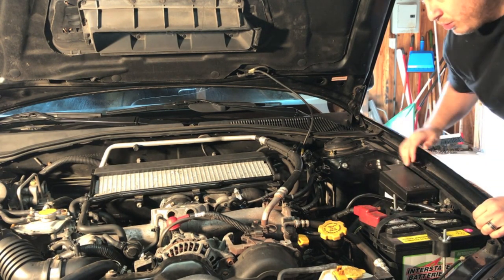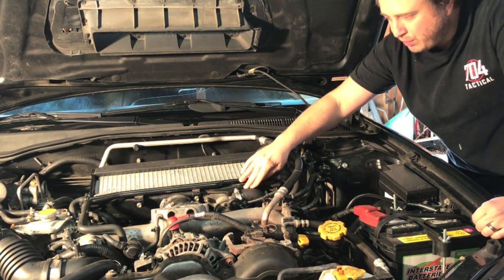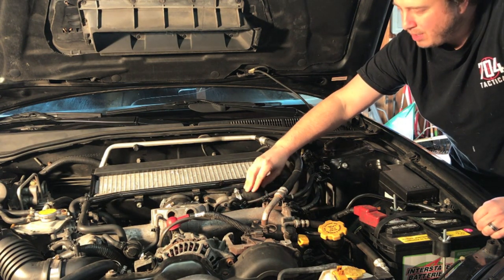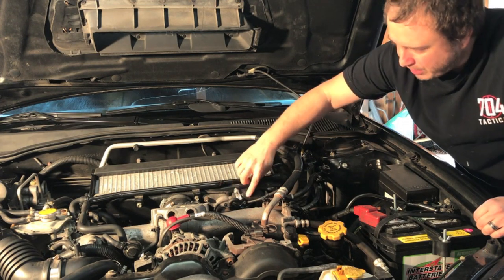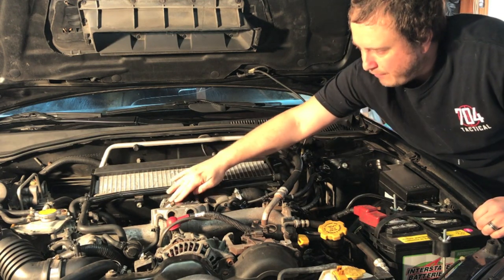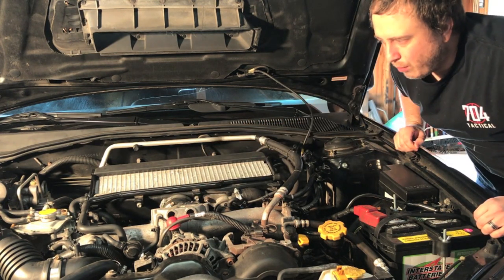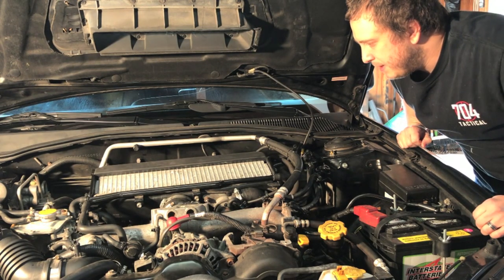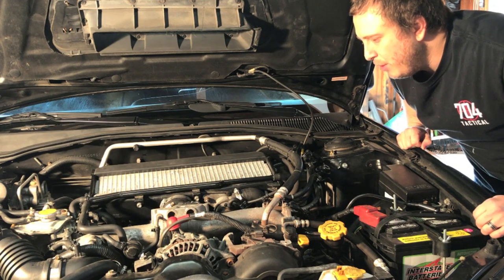First, disconnect your battery to make sure you don't short anything out. First thing we're going to do is remove the intercooler. I'm also going to replace the bypass valve air hose because this one looks like it's been taken off a couple times — someone threw a hose clamp on it, it's all rough and cut up. I also have a coupler for the throttle body because that looks a little rough. Hopefully it will fit — it's not an OEM one, I might have to buy one. But yeah, this is all pretty simple stuff.